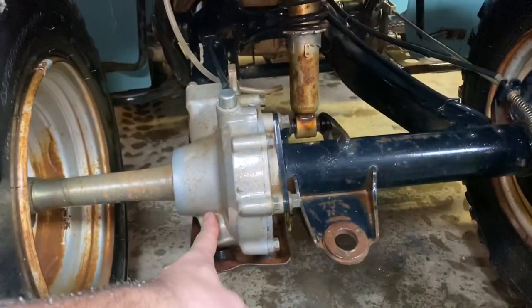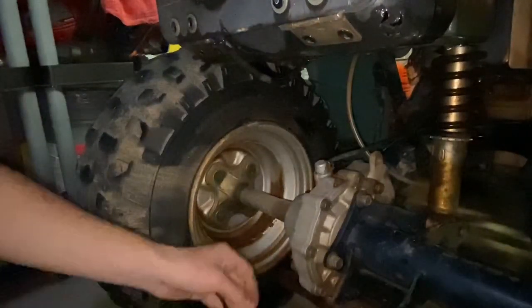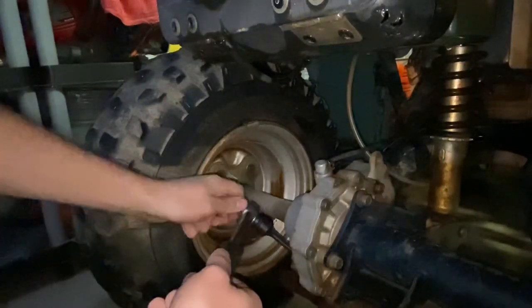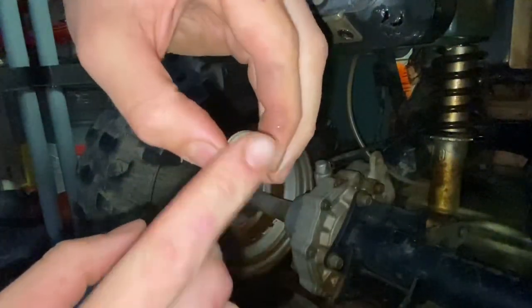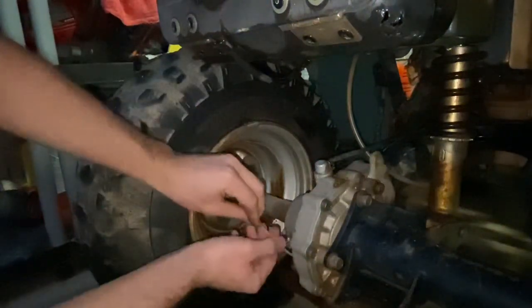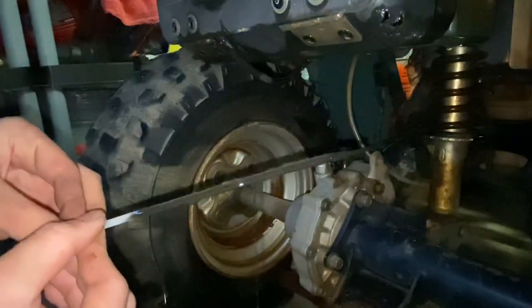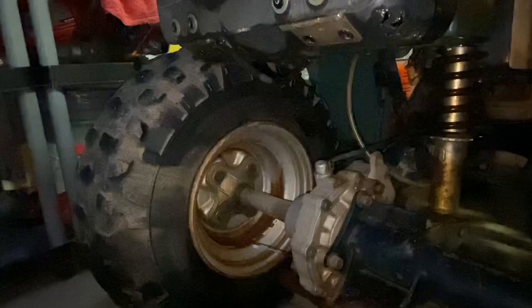So that's why we're going to be tearing into the rear brakes first, and I'd also like to check the oil in the rear differential. We're going to start with this rear diff here. I've already got this fill plug cracked loose. You can tell that this has been removed before, so hopefully someone has done some sort of maintenance on it. I'm going to stick a zip tie in there like a dipstick and just see what the oil looks like. Fortunately, it's not very dirty, not watery or anything. It smells like diff oil, so we're good there.